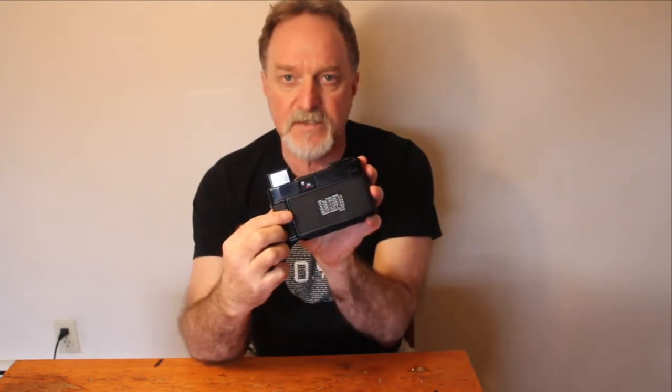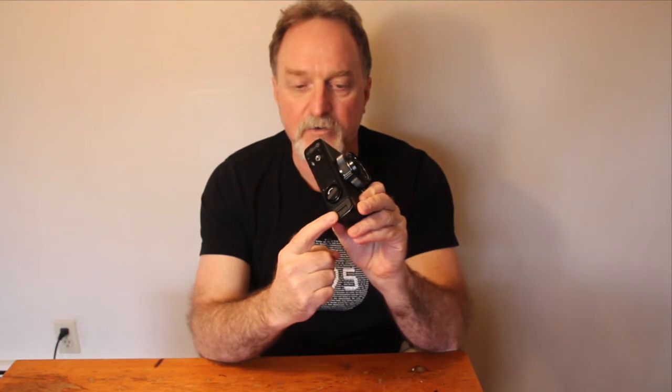You can probably see it on the top — when it's pulsing like that, it means the flash circuit is charged and you're ready to fire. The flash isn't bad for a little point-and-shoot; it's guide number 14 meters at ISO 100. Anytime you're using the flash, it sets the shutter to 1/30th of a second. The flash and metering circuit are powered by two AA batteries.